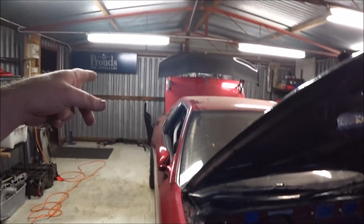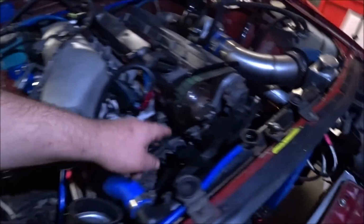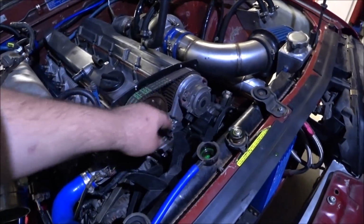And when I put the jumper pack on to start it, it wouldn't start, and I wasn't getting fuel. There was no injector tick. So unplug, take the CAS out, plug it back in and spin it with your fingers, and you'll hear the injector tick and the coils firing. There was no tick for the injector, and it took ages trying to troubleshoot that.